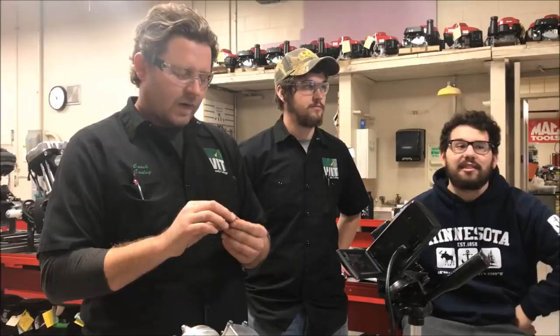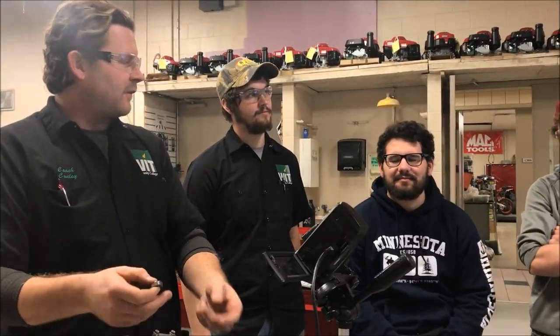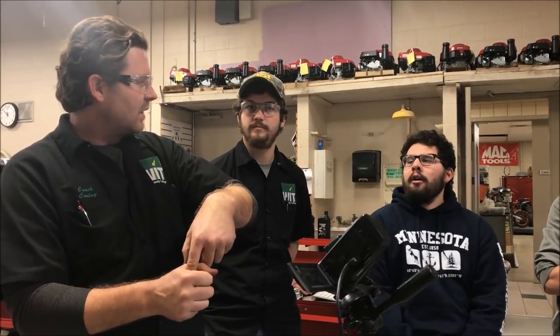More than anything it was just fun to play around and experiment. Where would you ever use this? On a camping trip, side of the road? I think this is still fun and it teaches you to think outside the box — to think about physics. A trick I've seen used is removing snowmobile clutches: tip the engine upside down, put water down where the bolt goes, thread in the clutch removal tool, and the water can't go anywhere — it creates pressure and pushes the clutch off.